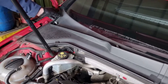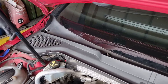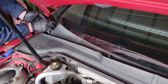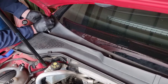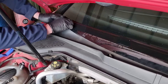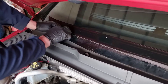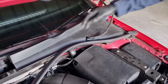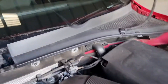To remove the main panel, starting at one end just pull it up — it's pushed straight down into a little channel below the windscreen. Wiggle one side and you'll notice it'll pop out. As it pops out, just work your way along; it gets easier as you get your hands in. You can then take this side off, take the rest of the rubber trim off, and move that out of the way.